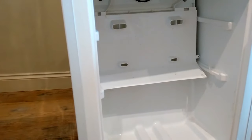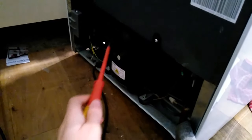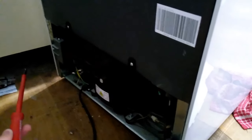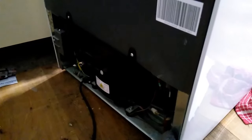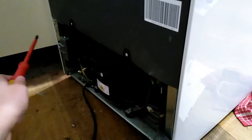I've watched quite a few videos on YouTube and a few websites on how to fix this, and all of them seem to say that the freezer has a self-defrosting mechanism — it warms up and melts the ice, which then drips out at the back. On this model there's a compressor and on top of it there's a drainage tray. Most solutions say there's a pipe that drains into this tray, it blocks up, you unblock the pipe and that solves the problem. Well, not in my case — the pipe is very short, drips straight into the tray, the tray seems completely dry, and the pipe is completely clear, so there doesn't seem to be any blockage.